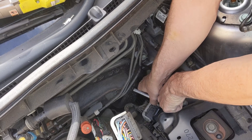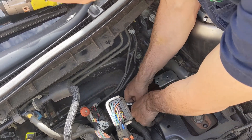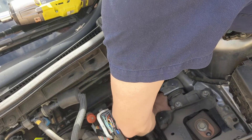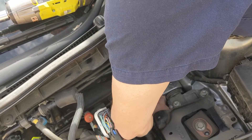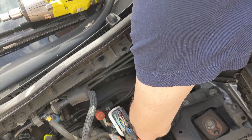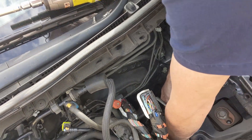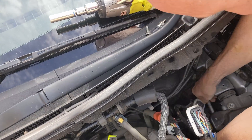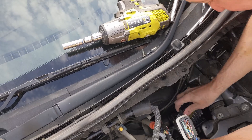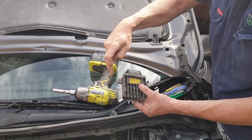Normally these bolts take a lot longer to access, but because of how this car is bent I can get to them. Imagine the TCM there — we've just taken out the bolt there, there's another one in the middle, and another one at the rear. The rear one goes through a C-slot rather than a hole, so you don't even have to remove it all the way. There are your three bolts — one, two, and three.